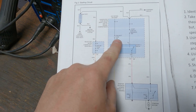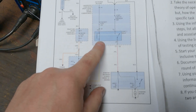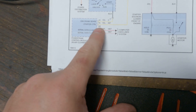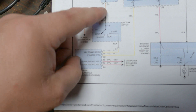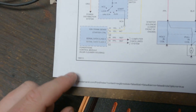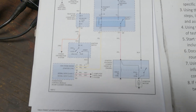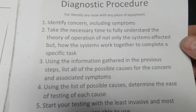This other one is a PCM battery fuse — a 10 amp fuse — hot in run or start, and that controls the solenoid side of the relay, which activates the relay and closes the switch. Following this yellow wire, this is a starter control at the PCM. The ignition switch fuse feeds 12 volts through the ignition switch. When it's in the start position, it tells the PCM you want the vehicle to start, and the PCM controls the starter relay on the ground side of the solenoid side of the relay. So now that we know how it works, we did step two.